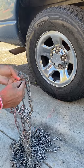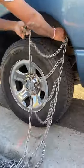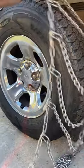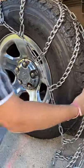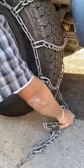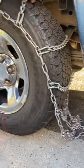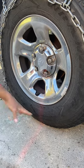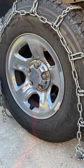The chain wraps on the outside of the tire so it doesn't cut into it. Just slide it onto the tire. It's probably easier going backwards — reverse the vehicle until the back portion of the chain comes around to the front, with the tire sitting on top of the chain. Back the truck up and I'll be right back.